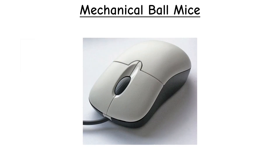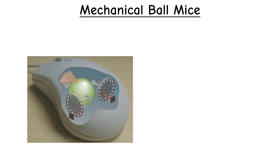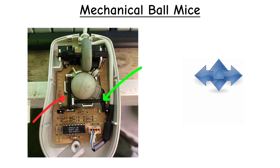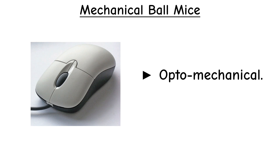Mechanical Ball Mice. The mechanical mouse, commonly known as the ball mouse, was the first type of computer mouse most people used. It tracked movement using a rubber ball mounted on the bottom of the device. When you move the mouse on a desk, that ball rolled and turned two rollers inside — one handling horizontal movement and the other vertical movement. Those rollers spun slotted wheels, an infrared LED shone through the slots, and a photodiode picked up the light breaks to track movement. Because of this setup, these mice are often called optomechanical.